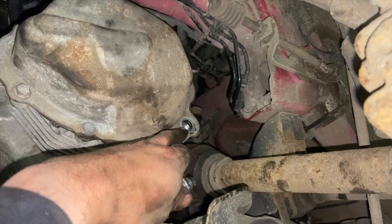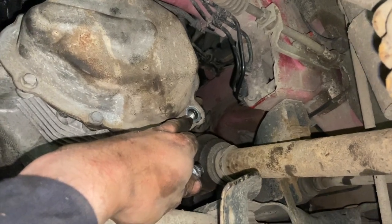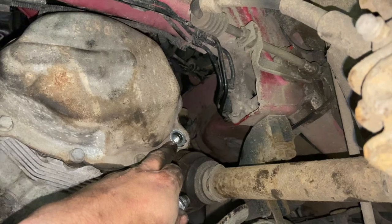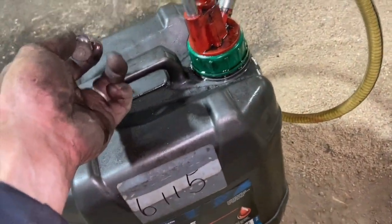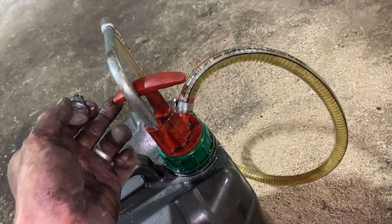I mean, the official quantity from empty is 1.9 litres of 75W-80 or 75W-90. So, we've got this style pump that goes onto the gear oil tub there. I'll put a link in the description below to one of these, because they're quite handy.